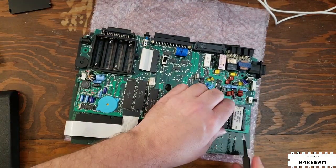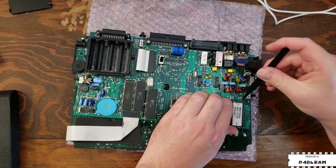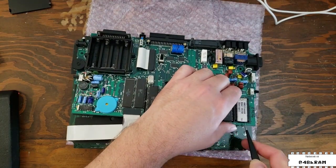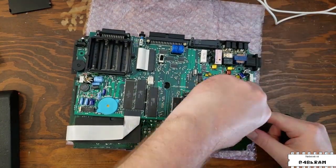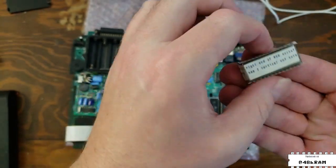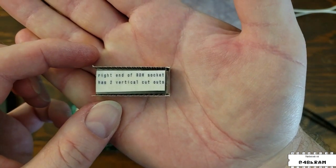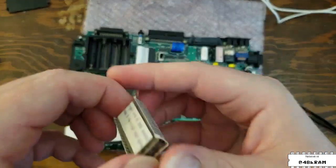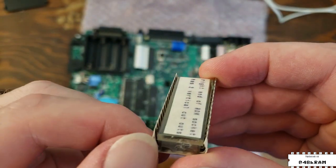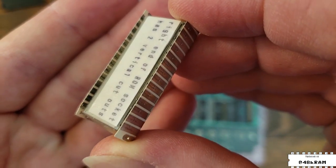Out of curiosity, I'm going to remove this ROM 2 Clouseau module and take a better look at the flat flex ribbon around it that allows it to interface with the M100 option ROM. It's a little bit difficult to pry out because there's no extraction ribbon underneath this ROM, so we're going to have to dig it out with sharp instruments. The legs of the ROM are actually up against conductive portions of the flat flex, and this flat flex is actually a circuit that remaps the pins from a standard JEDEC ROM to the pinout of the option ROM connector, which of course is non-standard. Thank you so much, Tandy.